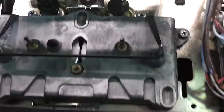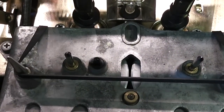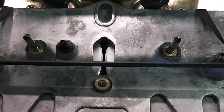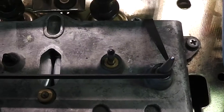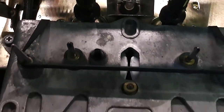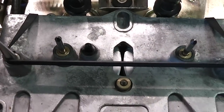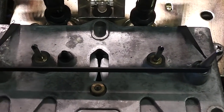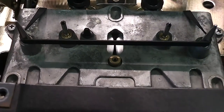I'm now at the stage of reassembly. I've lubricated the capstan bearings, with a little bit of plastic lubricant on the nylon supports at the back where the other side of the capstan flywheel sits. I've bent the belt round in the hope that it will make keeping the belt on easier. It's nice to be putting things back together. The amount of grease and bits of rubber belt to remove took a while, but hopefully I'm now on the home straight.